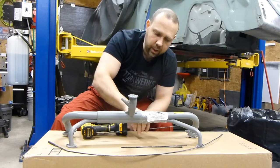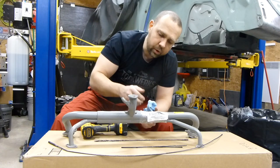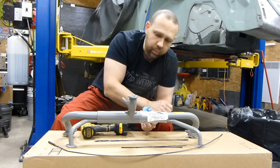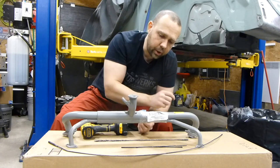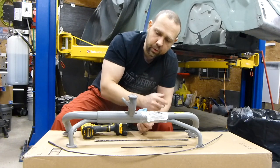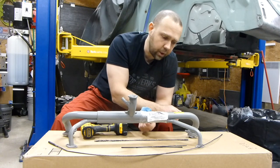All these parts would come out of one clutch cable. If you've got one broken clutch cable — and most VW owners would have one, because they tend to break at some point — you want to keep that. You could cut it up and put it away, or keep it in one piece until you need to do an intake heat riser cleaning on your car.